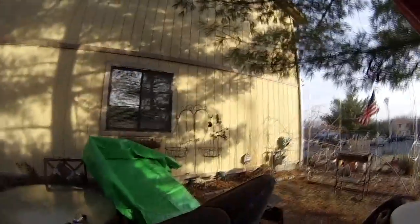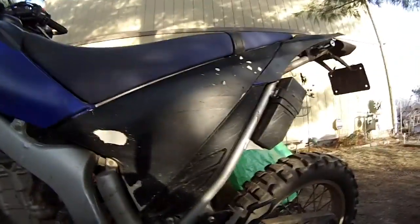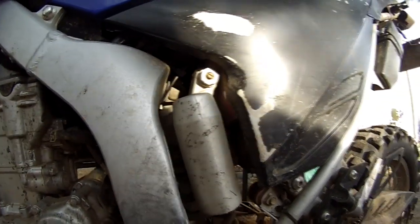What's going on everybody, NJ Bike Life. Today we are going to be adjusting the rear shock. On the trails it feels a little bouncy, so what we are going to want to do is adjust this screw here for the rear compression.